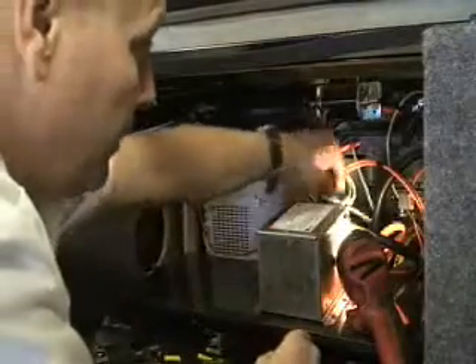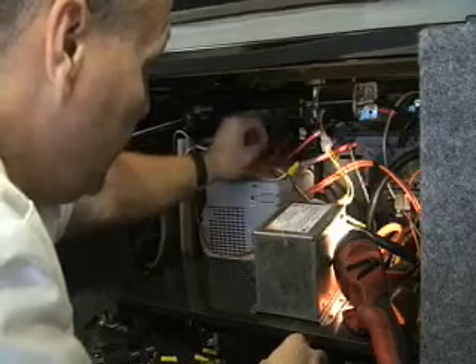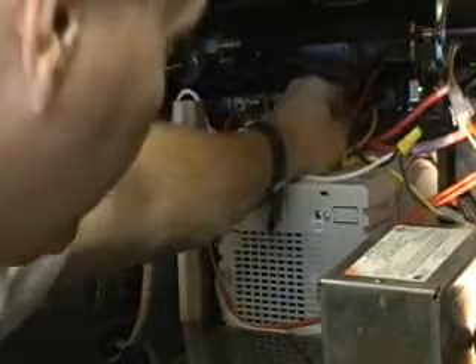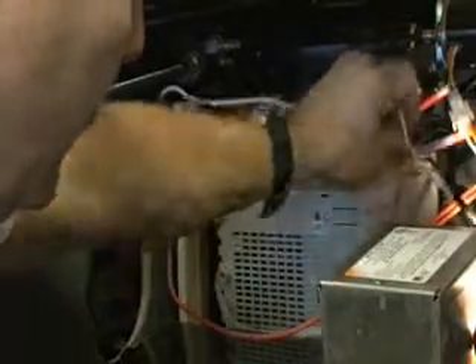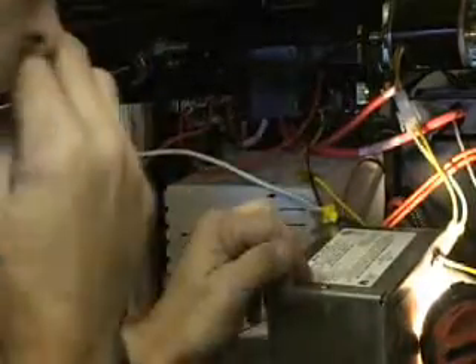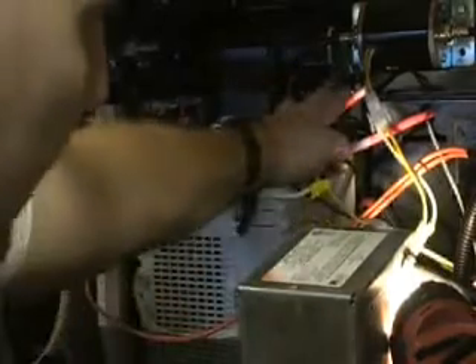These are my green and yellow wires coming down from my solar panel — green is ground, yellow is positive, 12-gauge wires. The yellow one goes to my charger as power coming in from the solar panel. If the charger indicates the batteries will accept charge, it's going to let current flow out into that 15-amp breaker I installed, charging the batteries. My ground: green's ground comes over into the Scotch lock here, this 12-gauge white wire goes to my main ground bus bar, and then my black wire is ground in the controller. The only thing left to do now is install the optional monitor, which runs by a CAT5 wire from the controller over to the galley.